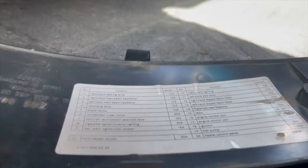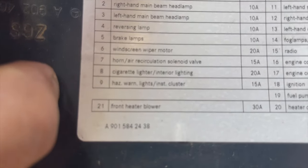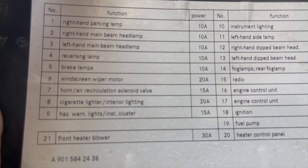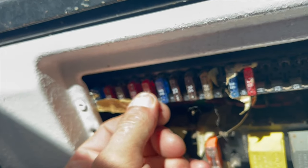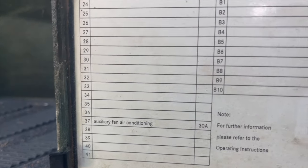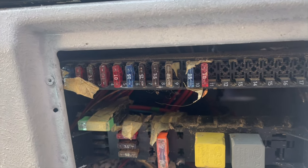On the steering column fuse box, the bottom two fuses — front heater blower, seems kind of relevant; heater control panel is kind of relevant. The rest of them don't seem very relevant to air conditioning, but it never hurts to check them all. You might find some other feature you didn't know why it wasn't working — it was just a blown fuse. Keep in mind they don't always look blown when they don't work, and sometimes they just have bad connections, so it pays to pull each one out, visually inspect it, and put it back in. Underneath the seat base we've got a couple more fuses to be concerned about. Under relays and diodes, line number four is auxiliary fan air conditioning; 37 down here is also auxiliary fan air conditioning. We just check it all and hope for the best.